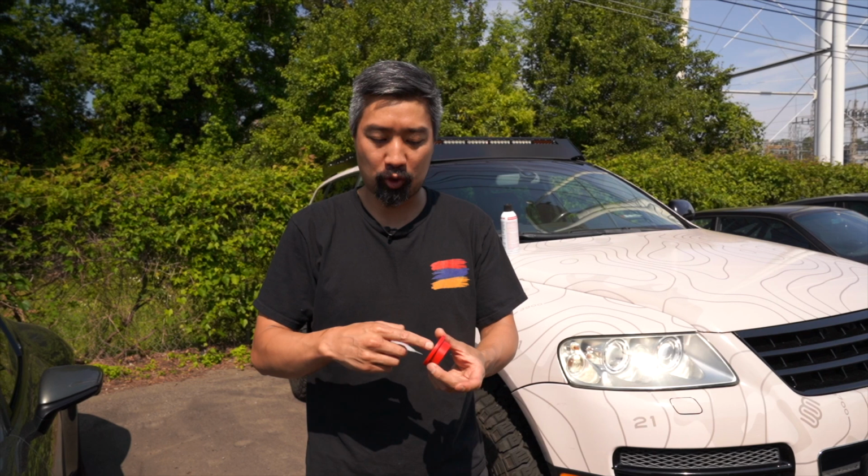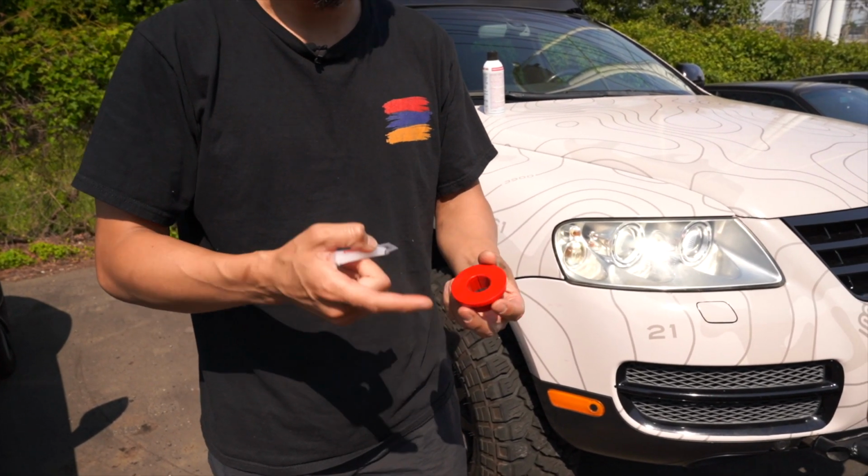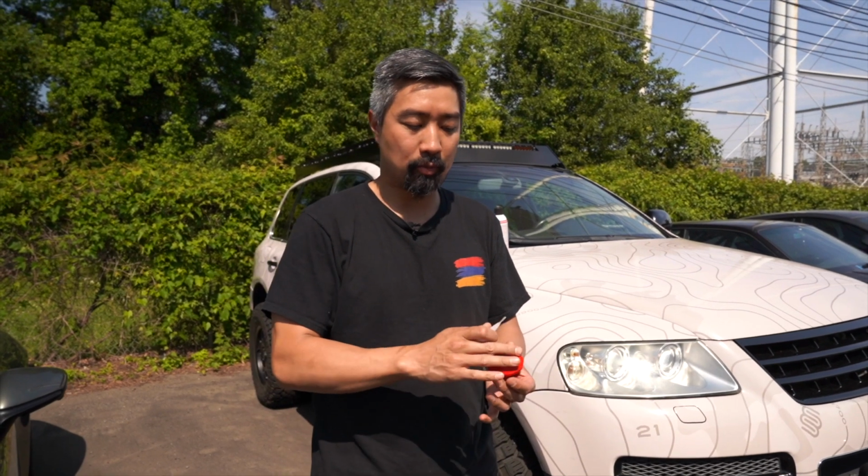When your control arms or the actual control arm bushings come, either way, we pre-lubricate inside the sleeve here to keep it from squeaking, and then we also lubricate the face. Don't be afraid to put a lot on there. The more the better. It will last a lot longer and go a long ways. If you have control arms, we pre-lube the bushings.